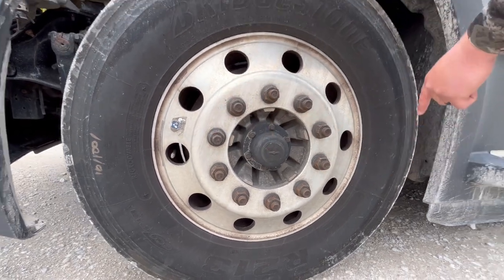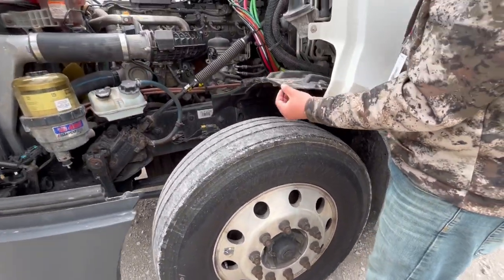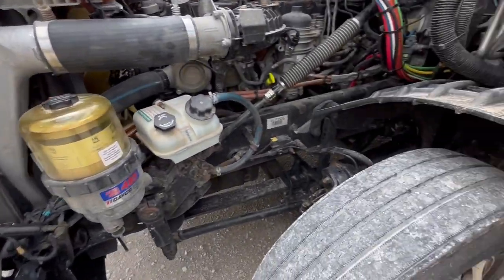This whole tire, checked with the gauge, needs to be no less than 100 psi. We have our splash guard here — properly mount secured, not cracked, damaged, or missing any nuts or bolts.